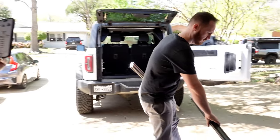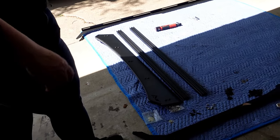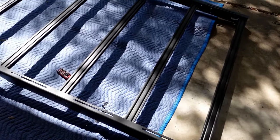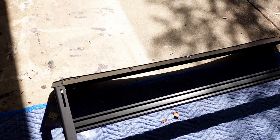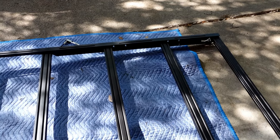It says make sure that the wind deflector is resting on top of the passenger and driver's side rails when you do so. We've got to start building it. We'll probably just put you guys on a time lapse for this because it's going to be a lot of holes. So if you guys can see, we did get the roof rack completely assembled here on the floor. Next step is actually putting it in place on the Bronco — it's going to sit on those threaded inserts behind that deflector — that's going to be a nightmare. And then it looks like we put on the back brackets right after that.